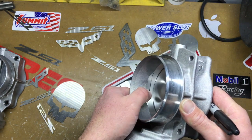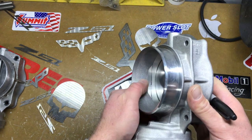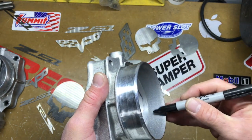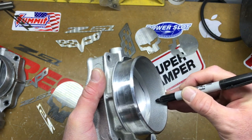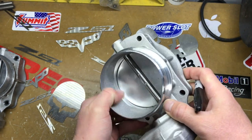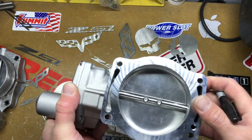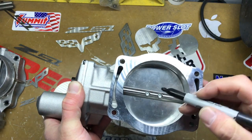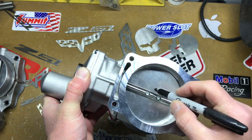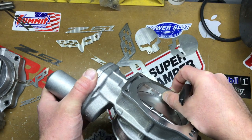The same applies to the front — you don't want to go past there, because when you move it in the light, no light gets through the bottom part either. The biggest material you're going to take off is right around here on this side until you get to that line, because there's a hump that when you flatten it out comes back to about here. And on this side there's a big hump right here, and that's what you end up taking off. You must make sure you do not go past that point. When you're taking this off, you want to mark it — you really don't have to take it off, but you want to make sure you don't machine or polish past it.